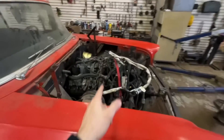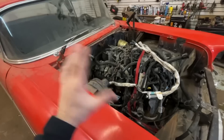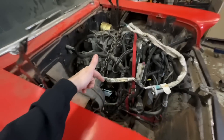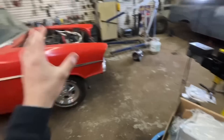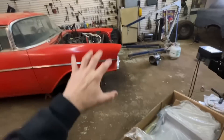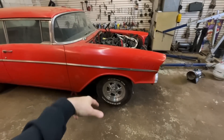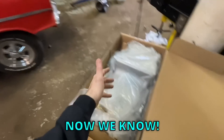In the last video I got the LS motor put in, but not really put in right. I have the wrong oil pan on, I don't even have exhaust on it, and a bunch of stuff is wonky — the motor mounts aren't even tied in, they're just sitting there. The stock oil pan I have is wrong, the stock exhaust is wrong, so none of that would work. I didn't want to make my mounts permanent until I knew exactly where it was going to sit with the right oil pan. Luckily, this is the right oil pan — it's made for Tri-Five Chevys with an LS swap — and I also have the exhaust for it.